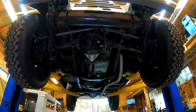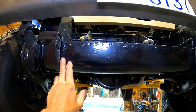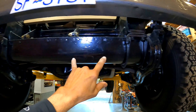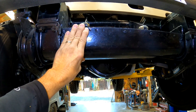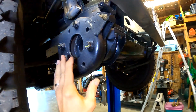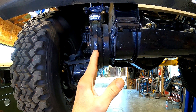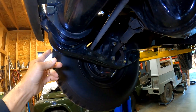These have what are called flexiter torsion springs. They're mounted inside this housing. There's a giant bushing on each side, vulcanized to the inside of this beam. Then this tube inside is vulcanized to the inside of the bushing with a flange right here. The swing arm — or control arm, trailing arm — is mounted to that.